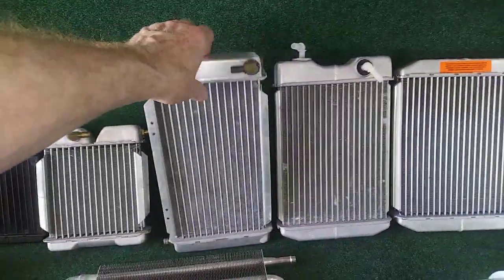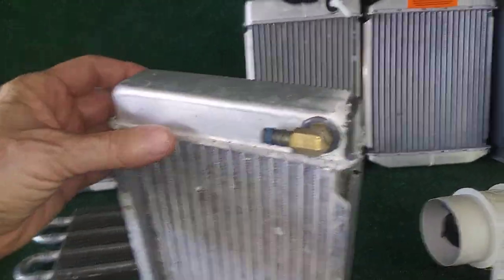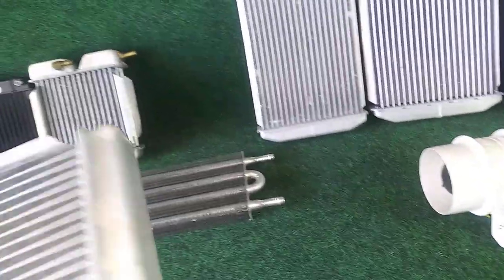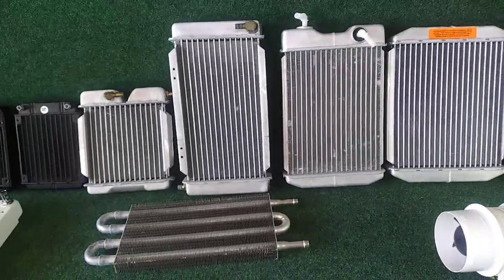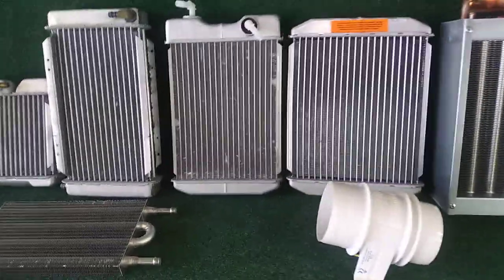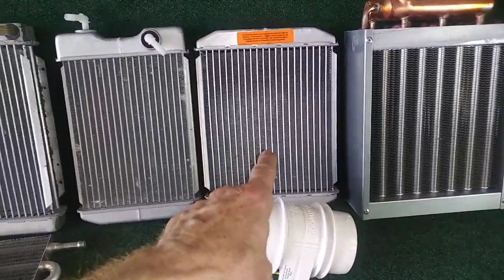This here I've used in tests — it's also a little too thick for that fan. In the configuration, it's also a heater core, and what I do is cut the tubing off and then block what I don't want to use. On this one I've got a barb fitting on the bottom and one on this end. So not that these are bad or good — there are just certain configurations you've got to work with. That's a perfect match right there, and so is that one. You can almost look at them, and I'll put a description for that online.